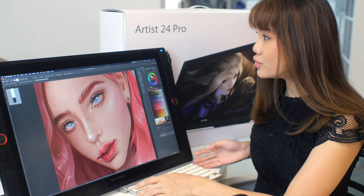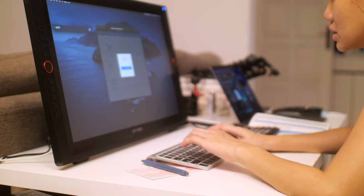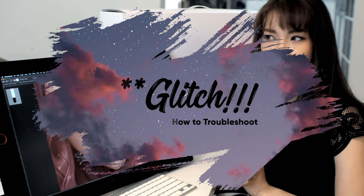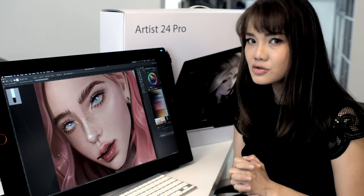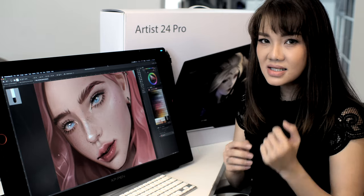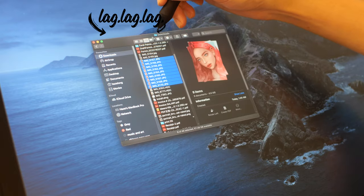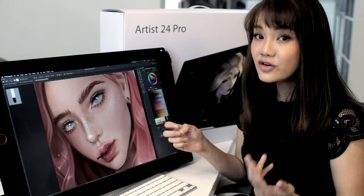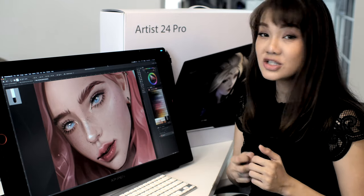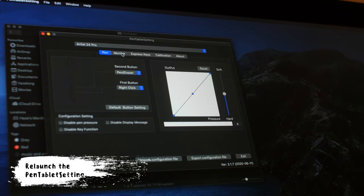For my setup, remember to get a keyboard — the screen is so big you have no space for a laptop in front of you as a keyboard or trackpad. I also want to mention a glitch I had: after installing the driver three or four times, I couldn't replicate it, but I've mocked it up for you. The glitch happens when you turn on your computer and display, and then windows stagger and lag when dragging, and stylus strokes come out as dots instead of strokes in Photoshop. The quick fix is simply to relaunch the pen tablet settings app — that solves it immediately.